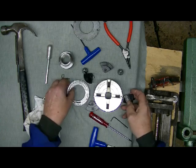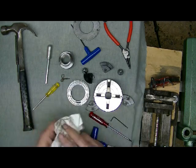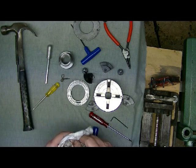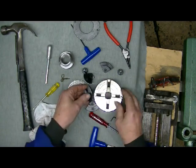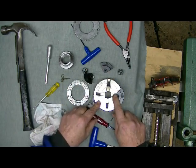Okay, so we've got it all apart — wash everything up, lightly grease it and then we're going to start putting it back together again. Assembly is the reverse of pulling it apart. Get jaw number four, make sure you get it round the right way, slip it up into there against the stop.